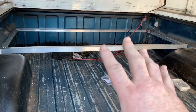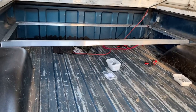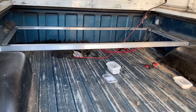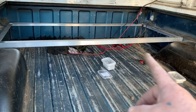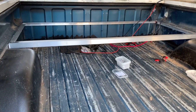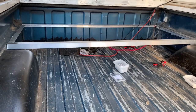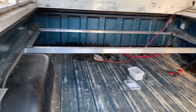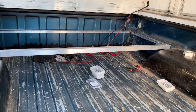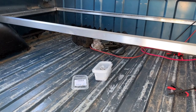And this is super light. If you would have put these as 2x4s, you would have already added probably about 25 pounds to your build. If you were to grab all those together, there's maybe 8 pounds there. So you're saving weight, and none of this will rot or soak up water. And as you can see, it's pretty easy to do. It's not too bad. All right, guys.